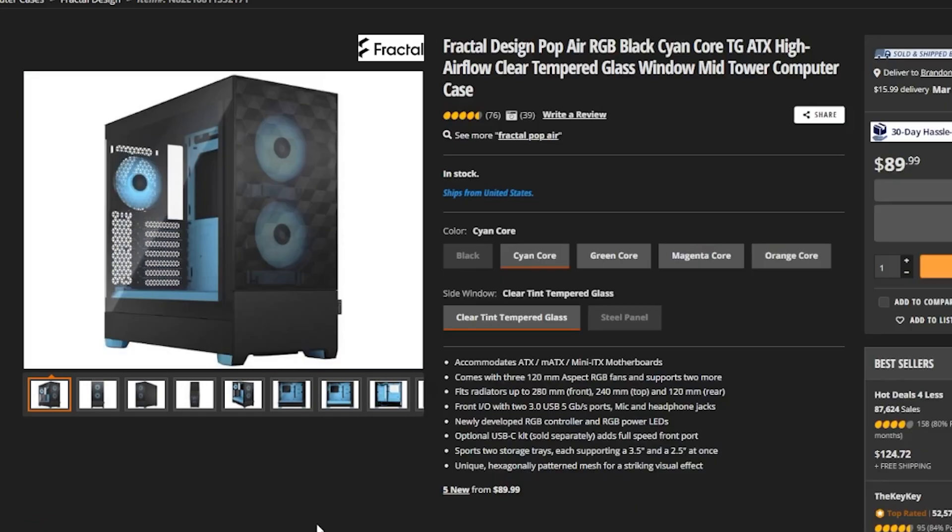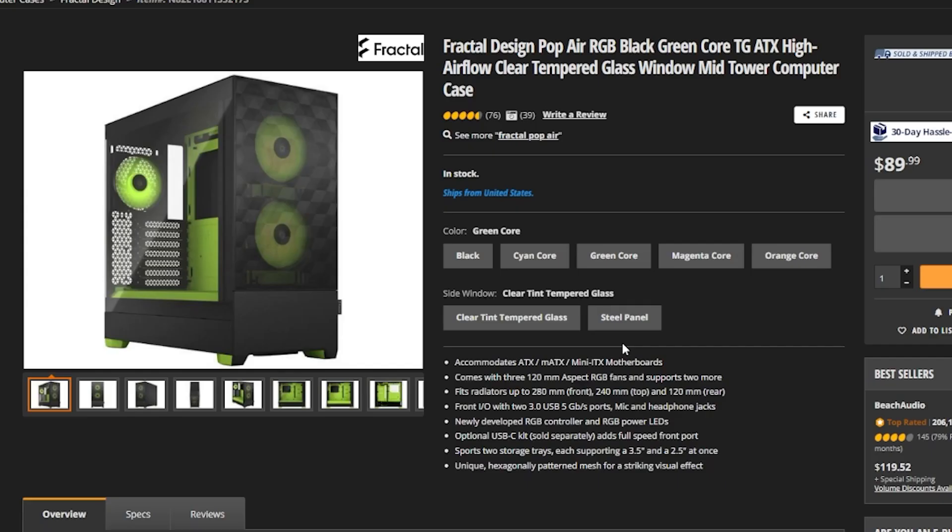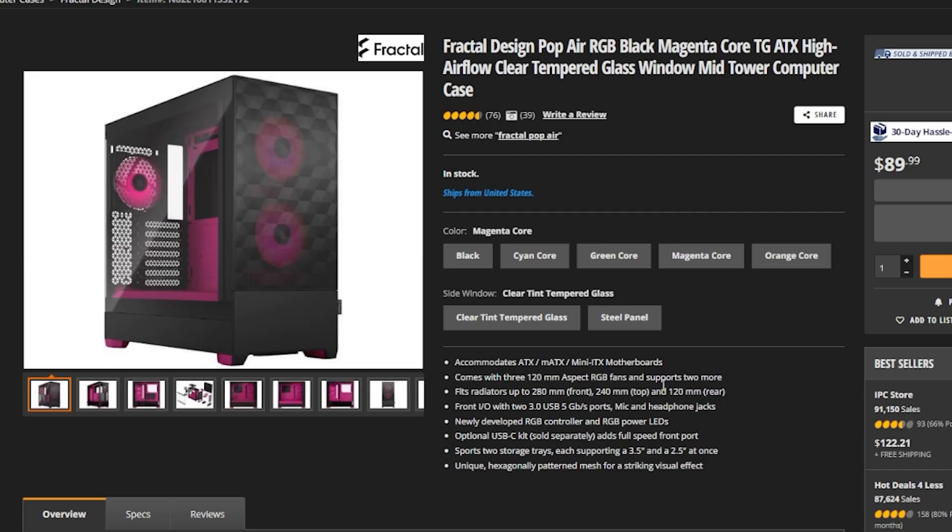While the colors are really cool from the basic version, the XL does not have such options — it only comes in white and black. Based off of the 'air' portion of the name, you can assume that this is an airflow-focused case, and it actually has some features cut back for water cooling, such as the top only supporting a 280mm radiator and the front supporting a 360mm radiator. But where this case lacks a lot of frill, it makes up for in spades by its price alone.